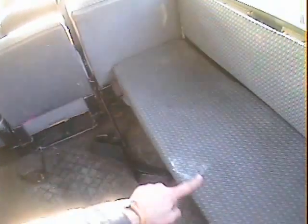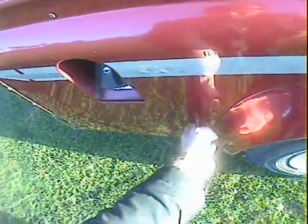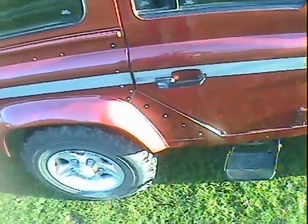In the back you've still got the rear seats. There's a mark on the offside rear seat and the stitching has come away on the top where it fastens down — it just needs to be tucked back in on both sides. On the offside rear there's a slight depression where the spare wheel has opened against it. Looking down the offside it looks pretty straight, with a couple of dents in the barrel sides and scratches just behind the rear eyebrow. There's some paint loss on the guttering where the roof rack's been, and that alpine light has been sealed on that side too. The modesty cover is a bit crinkled on the offside rear corner.